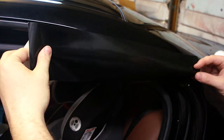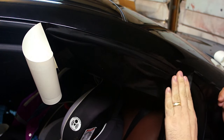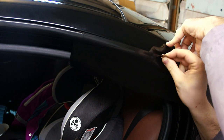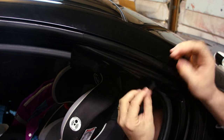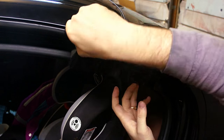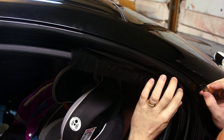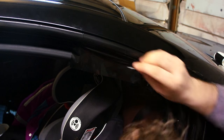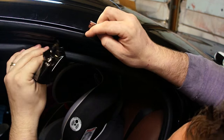The last part I had to finish was a little 12-inch stretch that looked simple but turned out to have quite a bit more curve to it than expected. I used a longer piece, trimmed the overhangs, and ended up having to make a few relief cuts so I got the top where I wanted it. I used a lot of pressure along the whole top and down along the bottom, then came back with the razor blade to notch it so it curved in easier. It's worth mentioning that you should clean everything off really well — I used acetone to get any wax off, and I'd also use a tack cloth from any auto parts store for a couple bucks to get any dust off, especially with the grills where I did all that sanding.